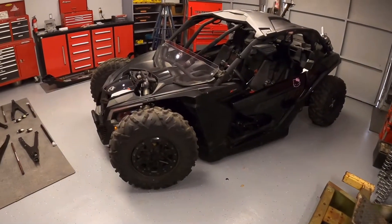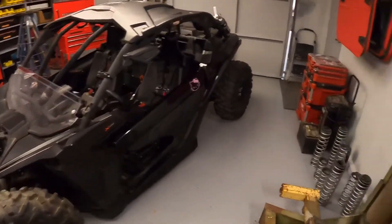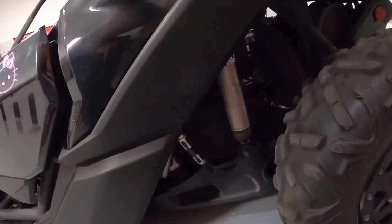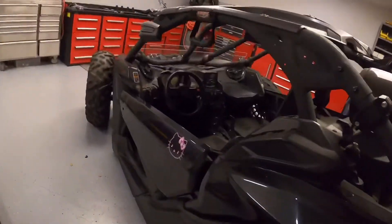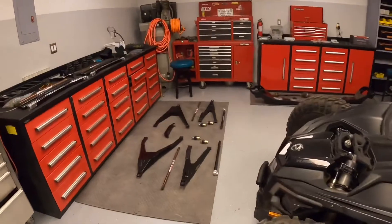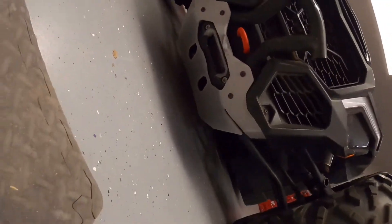Here is the methodology we're going to use. I took my wife's 64 and in the process of converting it to a 72 inch model, one of the first things I did was take the springs off, which drops the car down to a position similar to what would happen if you took a big jump or fully bottomed the springs out. So this is your worst case scenario — not going to happen for everybody. If you're a rock crawler, you're probably not going to fully bottom out like this. If you're running slow, you won't bottom out like this. If you run in the dunes or high speed trails, you will bottom out at some point. You can also see how little clearance you get under the car during that compression. We're going to fit the tires on the car like this and show you the interference with the fenders, and let you decide what tire you want to run — but this is truly your worst case scenario.